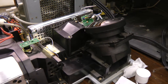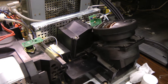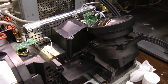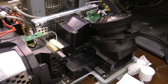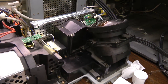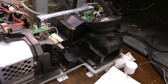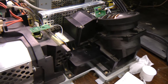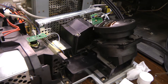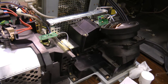That's all back together again. For the previous video, a bunch of people had asked when I was going to show the DMD chip — and actually, I already did, at the end of part 2. For those of you who don't know, DLP stands for Digital Light Processing, which is the name for this whole system. And DMD stands for Digital Micromirror Device, which is the actual chip that has the microscopic mirrors on it that produces the image.